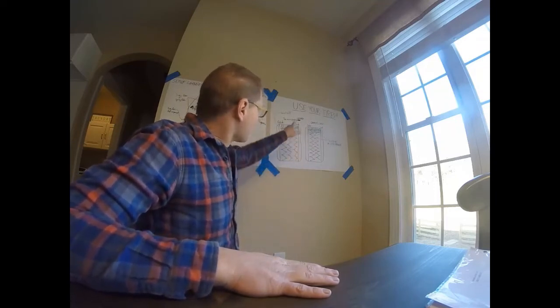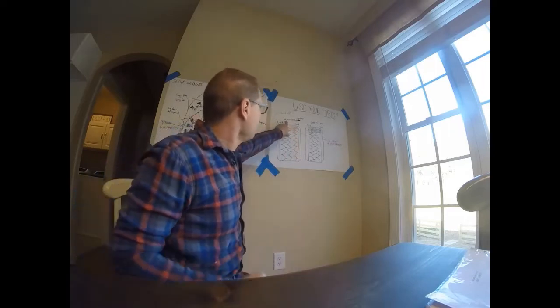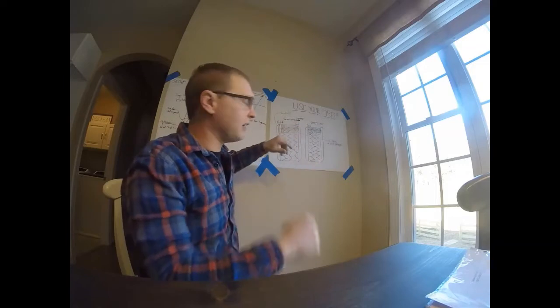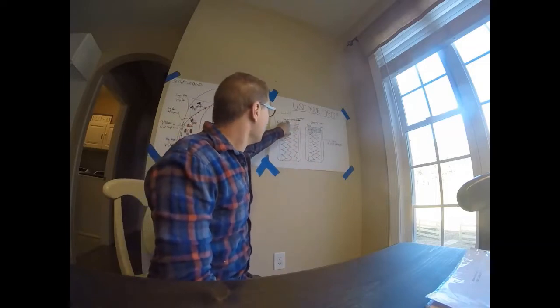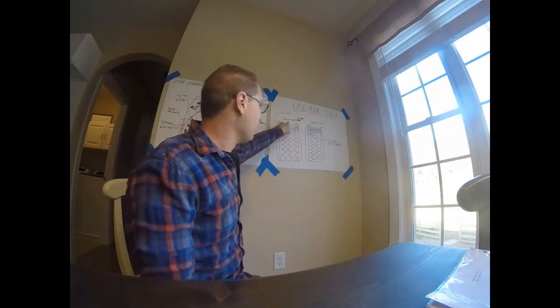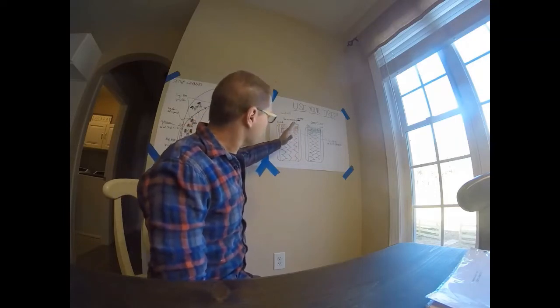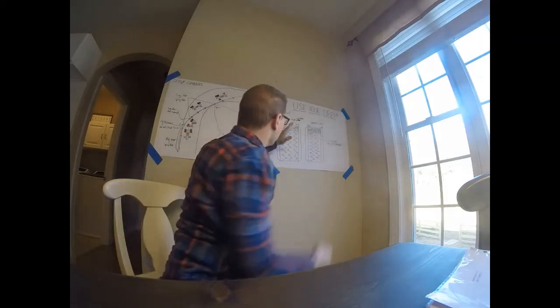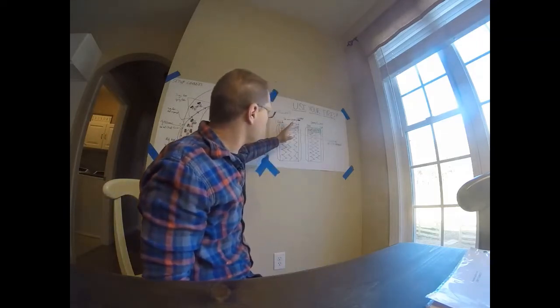So, one thing to note, particularly when a lot of guys are coming over from slicks, sometimes they'll have a lot more negative camber. This is what too much negative camber looks like. If this is the outside of your tire and the inside here, so the tire would be pointed like this, center line of the vehicle is here. The tire would be cambered in like this.